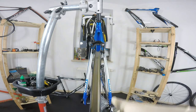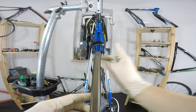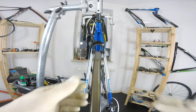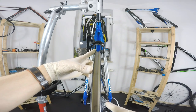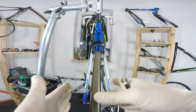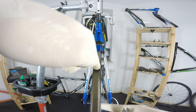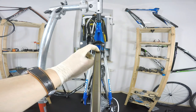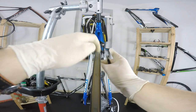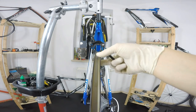We have some pad rubbing here on the left side, meaning that I would like to put some more tension on the right. Very important rule here is not to operate with just one spoke. You will see how long this bend on the rim is, and then find the center of this bend, which is this spoke here, but it goes through like four spokes. I'm gonna start working on the one in the center of this bend and then a little bit on those that are just next to it.